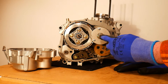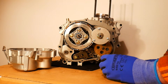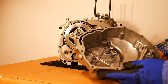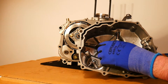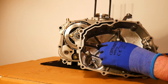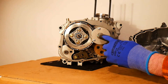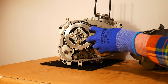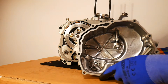As the oil is pumped around the motorcycle engine, it is actually pumped in through this little valve here. It's pumped in through here from the actual clutch cover - here we have our clutch cover, and it's this little outlet here on the clutch cover from which the oil is received into the little hole in the valve, and it flows into the centrifugal oil filter through that little valve.